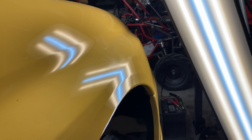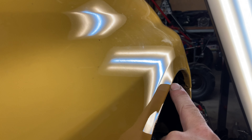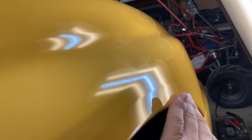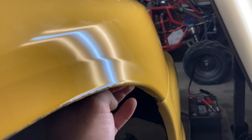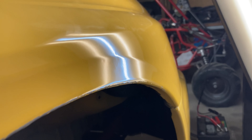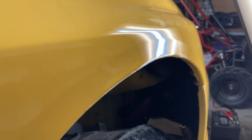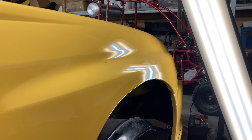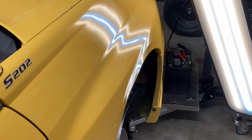Next thing to do before I straighten this flange out is get this fender back in shape. It's pretty good right here but out pretty far right here. By rolling the front, it actually brought most of that bow in the front in as I was drawing this down. Now we just have this back area to work on, and there are a few other nasty spots in this fender I'll clean up as well. Very happy with that for a first pass.